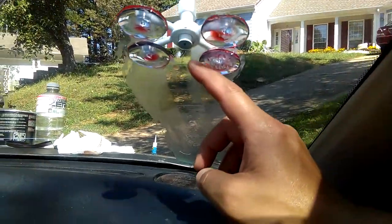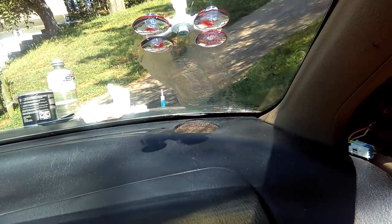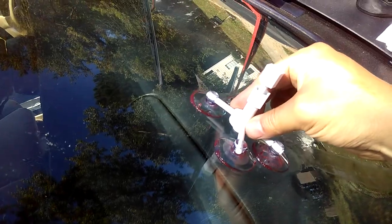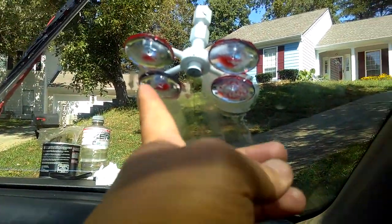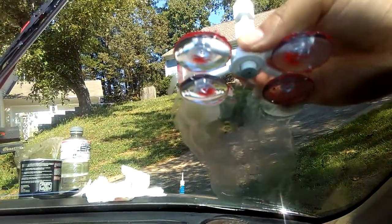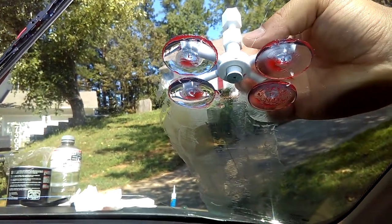And yeah, that's called the rubber mouth. The applicator base is the whole base right here — it's called the applicator base. Hold it with this hand and push it up, slice it really slowly. Use the other hand to go inside and look, and push with each side of the glass so the crack opens up so the resin can fall into place. Do it really slowly — maybe five to ten minutes per inch of the cracks.